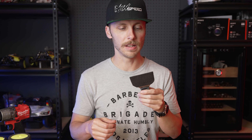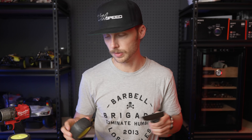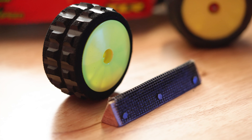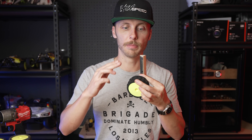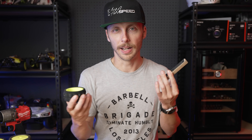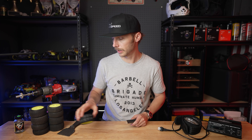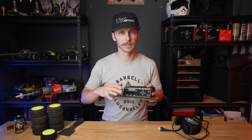Highly recommend you make one of these — really easy, just find a flexible putty knife wide enough to fit the carcass of a tire, add 80-grit sandpaper, and done. As a bonus tip, I'll show you how to do a Zeek mod — a variation of the V-cut on an insert — using this cool little tool from the Team Rattle Can guys. It's pretty tedious to sit there with scissors cutting each rib and hope you're doing each one the same. But when you flip the insert inside out on a rim, mount it up on the drill and spin it — super easy, very consistent. Highly recommend it.